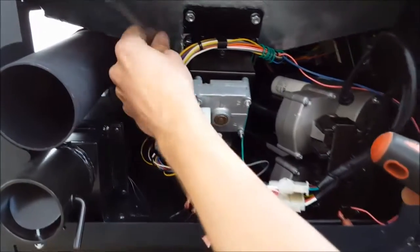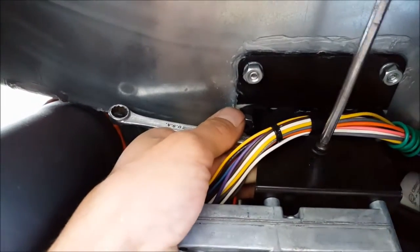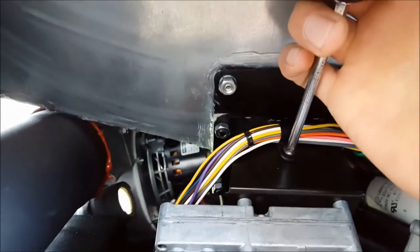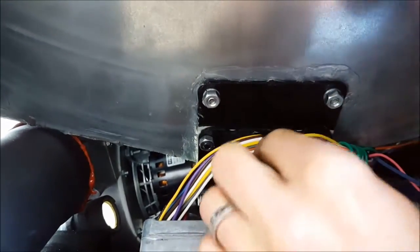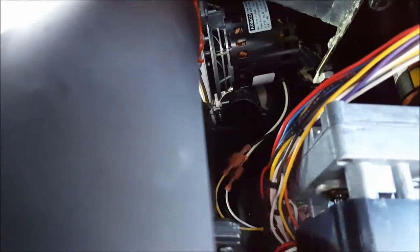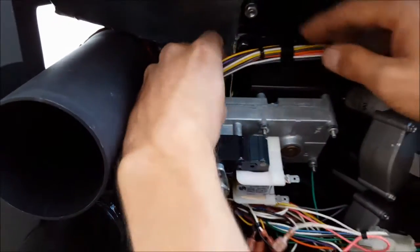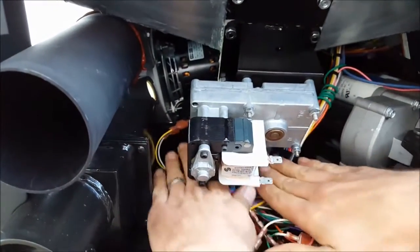Next, we're going to go ahead and disconnect the wire harness from the motor bracket using a 3/8 wrench on the inside. I like to remove the screw and the nut so you don't drop them on the blower shelf and lose track of them. On the bottom left-hand corner, you'll notice the zip tie holding the wire harness in place — carefully snip that so you don't catch any wires. Pull it straight out, then take your entire harness from the top of the motor and tuck it underneath the motor.